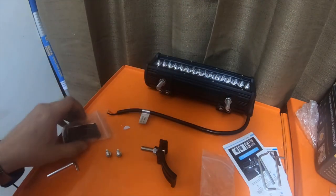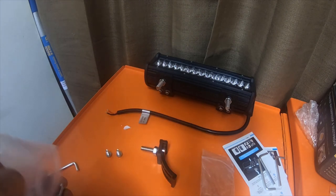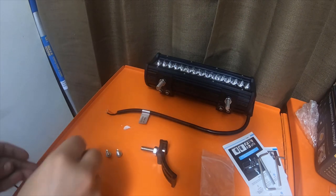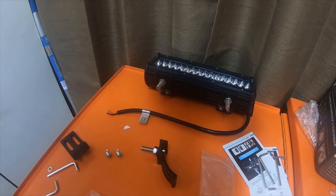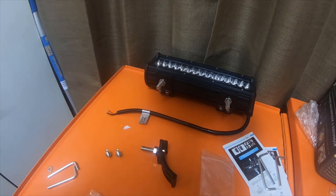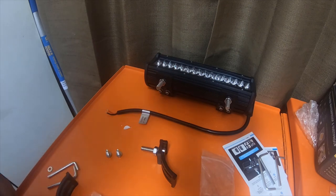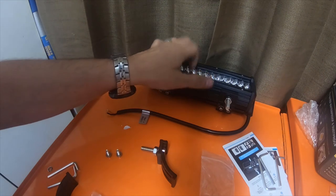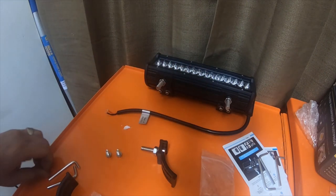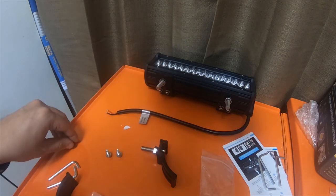These were a little more expensive than the ones my wife bought me from Walmart. Those were like $20, but they were halogen lights. They're not very bright, and I can't go any higher than a 130-watt bulb. And the problem with the glass in the desert here is the bottom ones that I had on the bottom of the ram guard, that's the third set, because the glass keeps breaking because rocks keep bouncing up and hitting them, just me driving down the road. So these have an acrylic or some kind of plastic clear lens, which might take the rock abuse a little better.